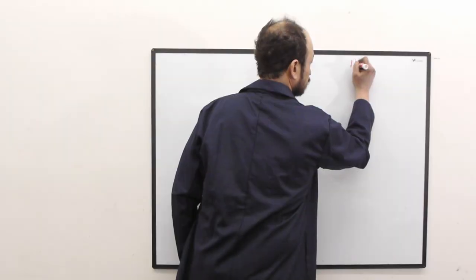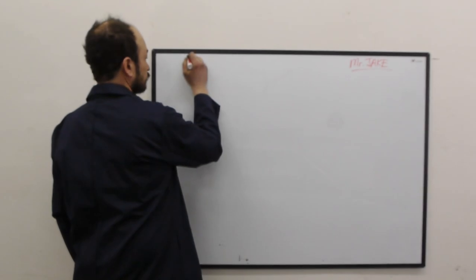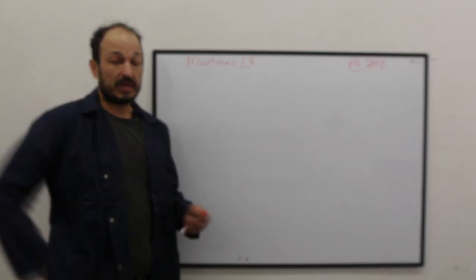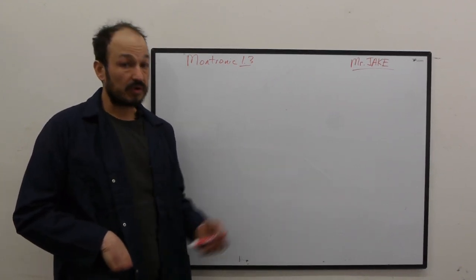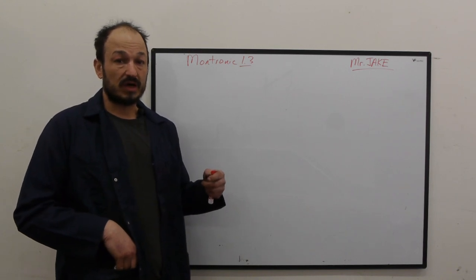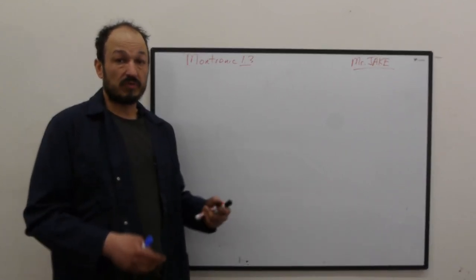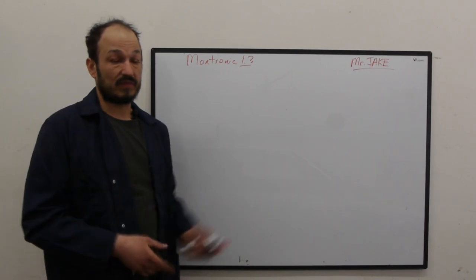Okay, so first of all, Mr. Jake, that's me, and then Motronic. There are different levels of Motronic. 1.3 has a check engine light and works with a 55-pin connector. That's what is on the late M20s, and on an M30 car, so E34s, E28s, some of the 7 Series, and maybe some other non-BMW cars. Motronic 1.3 is what we're basing this around, but this applies to lots of different fuel injection systems. It's also very relevant to the Motronic 1.1 and even M42 Motronic 1.7 and later. Just the layout of the engine is what's different.